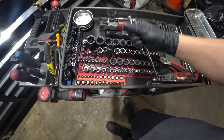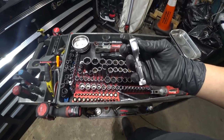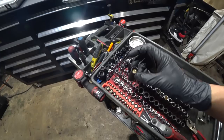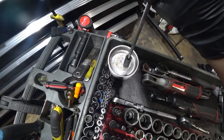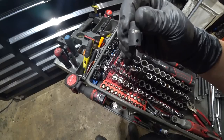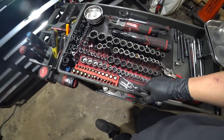I believe this is a Titan — quarter-inch hex and quarter-inch drive. Love this thing; hasn't skipped once. You could give it all you've got and it just hasn't skipped on me. Got Cornwell's finest deep magnetic sockets — love these. If you've never seen them: they're spring-loaded, so if there's a stud, as soon as the nut is loose it stays intact. The short ones are not spring-loaded — just regular magnetic quarter-inch sockets. Impact sockets go from five millimeter to 15 millimeter; deep sockets also from five to 15.